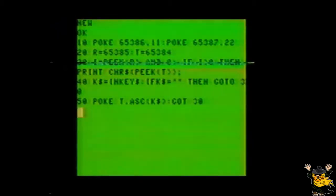Now, run your program, and your RS-232 cartridge will turn on at 30 characters per second using no parity bits. At this point, you can now send commands to your modem, assuming that it's got a command set. If it's a manually operated modem, you're still looking good right now.